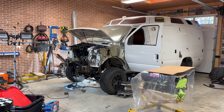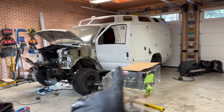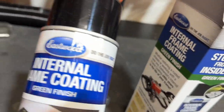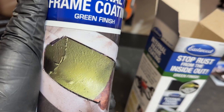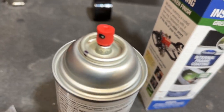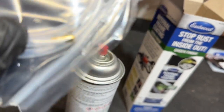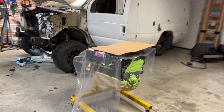Today we're working on that ambulance and I definitely have rust on my mind. Only the front section here is metal - the rest of it is all fiberglass except for the frame underneath. But we're doing some undercoating stuff internal. I have a product here called Eastwood Frame Coating. So it converts rust, encapsulates it, and seals it on the internal rust frame surfaces, anywhere you can shove this thing into any little crack. It attaches to the top and then you can shove that little tiny pipe into anywhere you can get it into, converting and encapsulating that rust, protecting the underside of that thing, also protecting some of the rust repair that we just finished doing.